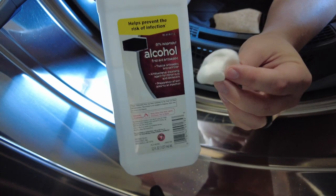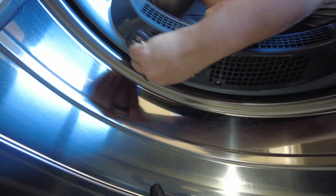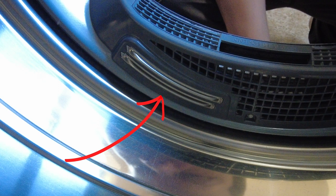If you notice your clothes are taking longer to dry than they used to, it could be a sign that there's an issue with the dryer moisture sensor, so it's important to take care of this sensor as part of your regular maintenance. You can clean it with a cotton swab and rubbing alcohol every few months to maintain accurate drying times and prevent over-drying and overheating. These sensors are typically located inside the dryer drum, either close to the lint filter or on the backside wall of the drum itself. They can also be placed around the door or inside the doorframe. What you're looking for is usually a set of metal bars or strips that come in contact with the clothes as they tumble — this contact allows the sensor to detect the moisture level in the fabric and adjust drying times as necessary.